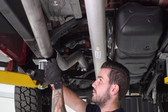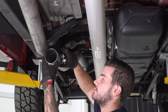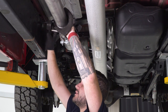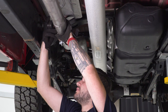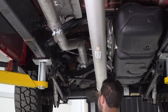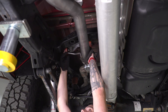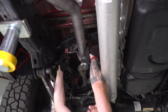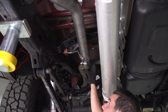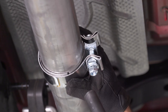When you do this, make sure there's a clamp on there. Slide this guy on — really easy. Once you have that in place, connect those two pipes. It is definitely easier if you loosen up the inlet pipe. From there, bring it up and slide the hanger into the isolator. If you need to, you can lubricate that isolator to make it slide in a little bit better. Before we tighten down our clamps, let's connect the isolators on this side. I'm gonna start with the longer one on the outside, slide that into place, bring that all the way in, and connect the other one. Grab your 15 socket and tighten down your clamps. Do the same for the other clamp with the 15-millimeter deep socket.